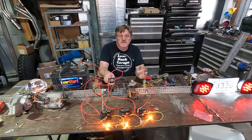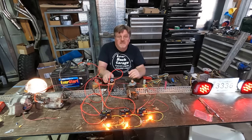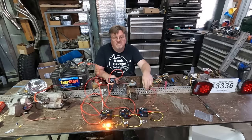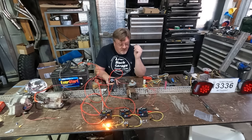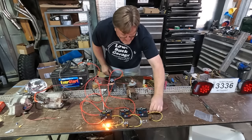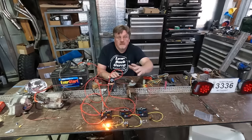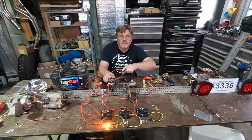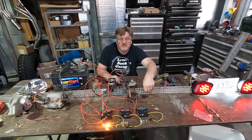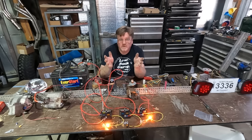This also works when you have it in the on position — all lights are on. But then you turn off your car and your headlights turn off automatically, even if you left the headlight switch on. That's not standard practice, but that's how I'm going to wire this one. If you want them on all the time but still have a switch, you just move your connector over to the on position — now no matter where your ignition switch is, even in the off position, you have running lights and headlights, just like a regular vehicle. It's all up to you what you want to do.